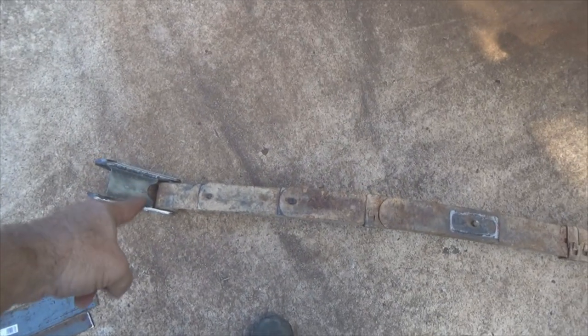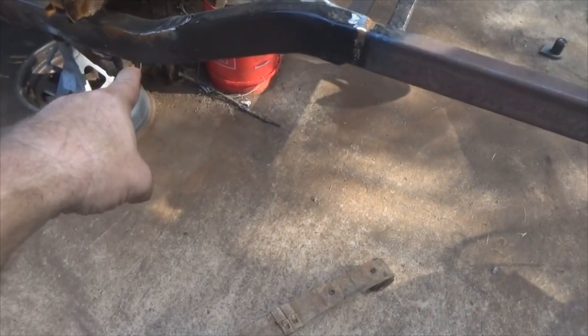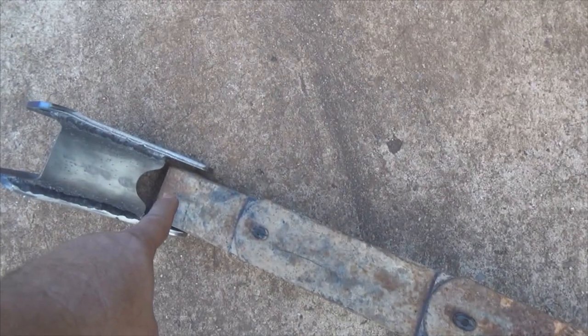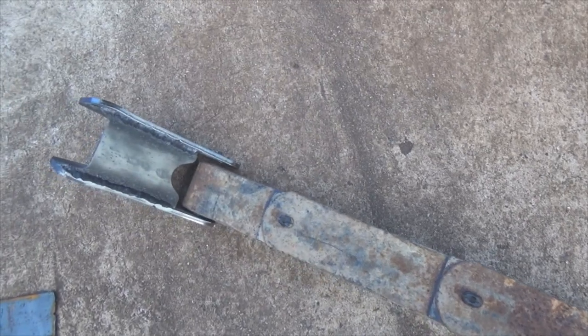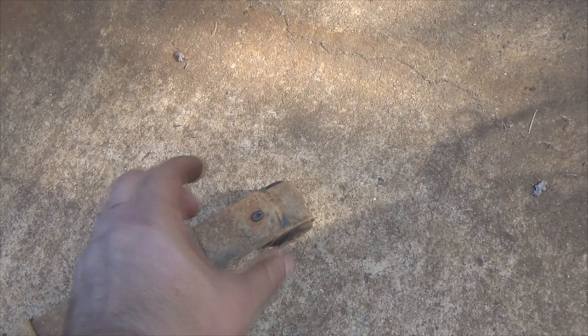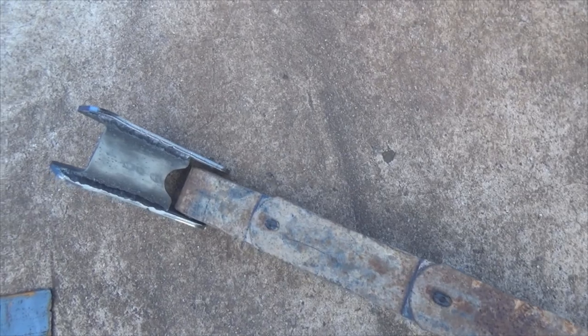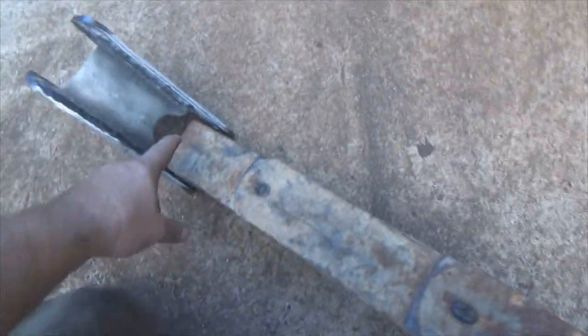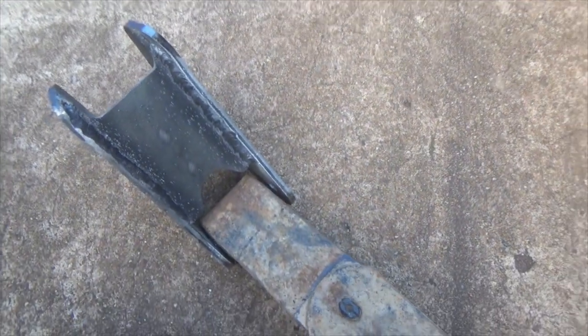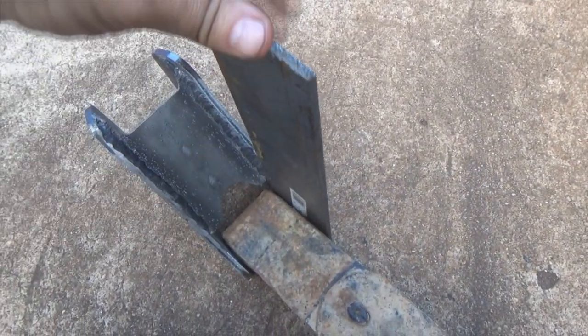Whatever you do on your stretch using Cherokee leaves, you want your small end here toward the front, because this puts your rear diff back here, pushing it backwards. But the catch is this end right here has a smaller bushing than this end. This area is about three inches — probably about three and three-eighths or so. This right here is two and about five-eighths. That's why I measured that. But this is three inch, so what we've got here is that gap.